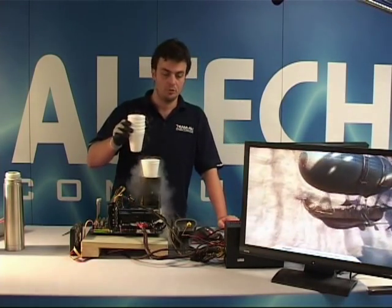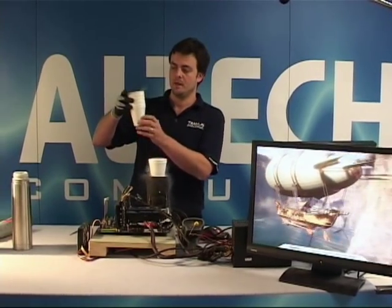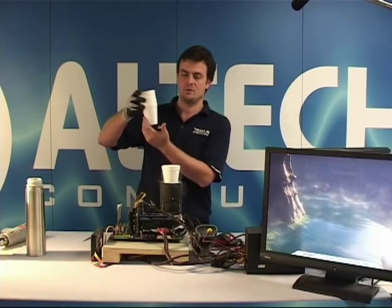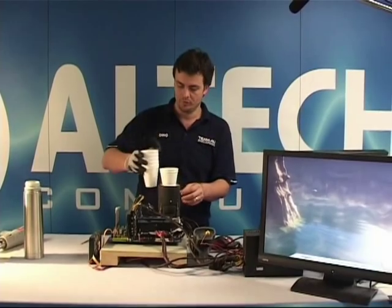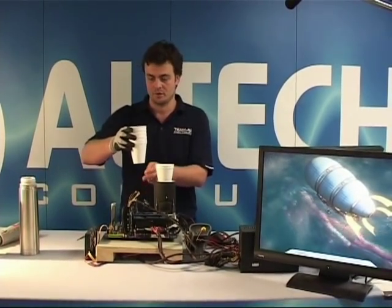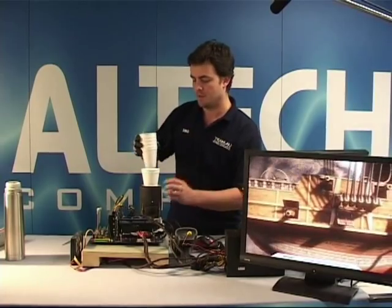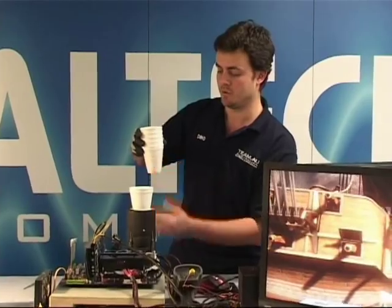See, I'm using small pours, very small. And also, if you're going to keep liquid nitrogen in this styro cup, just make sure you keep an eye out on the cup itself, because sometimes you'll have condensation forming around here. And if you're keeping it above your setup here, you can start dropping water on top of your setup. So it's good to design this area so that you can basically not go over the motherboard, just in case you've got condensation which could trickle onto the components.